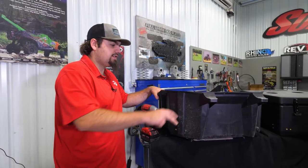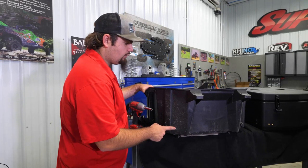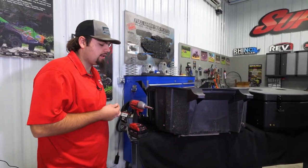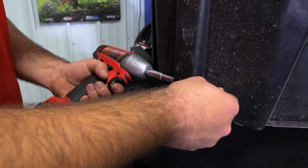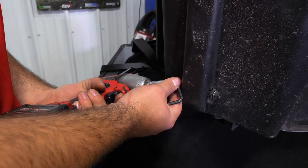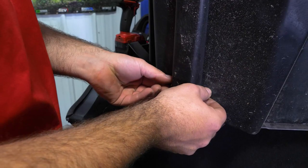When we're looking at the bed, this is the portion that is closest to the machine. You're going to see a couple bolts — one here and one on the opposite side as well. What we're going to do is partially remove these. You'll need a 10-millimeter socket and a 3/16ths Allen. Go ahead and remove the nut completely off the hardware, then slide the hardware straight back.